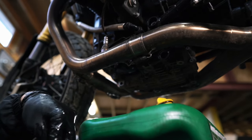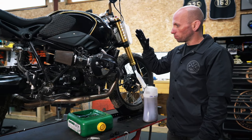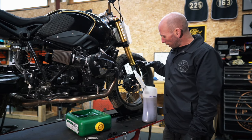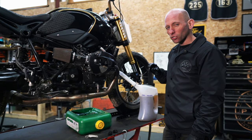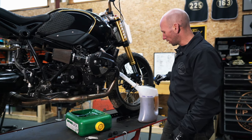Make sure everything on the bottom of the bike is torqued correctly: 32 Nm on the sump plug, 11 Nm on the filter. The first place this oil is going to drop if you haven't done these up correctly is firstly the floor, and secondly the rear wheel — see you later. The boxer engine takes four liters at the oil change stage. We tend to put in just a little bit below four liters, then check the oil level and top up to get an exact amount.